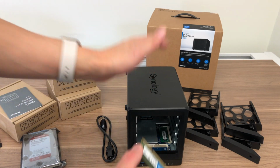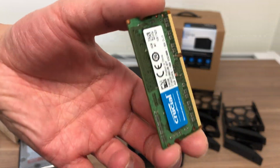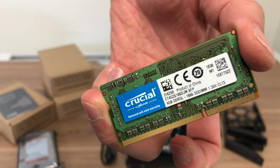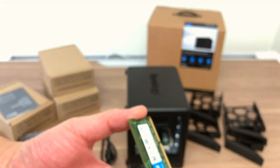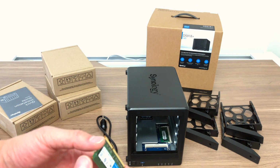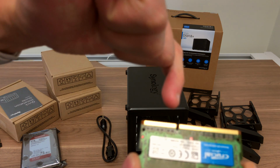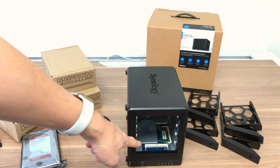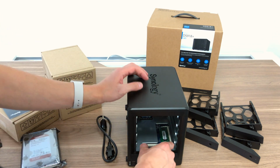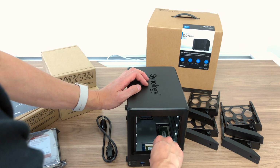Hey guys, so actually before I set everything up, I want to show you guys how to put in the extra RAM. So again, I got this off of Amazon. This is just a Crucial, and you can use this one. It's totally compatible. I'll drop the link below, right? And basically all you gotta do is, let's see. You have to take out all the enclosures, basically. What I do, I'll put it on the side like this, and just make sure that this little slot, the opening, is aligned with that opening right here. Like there's a little tab, and then you just put it in, and basically you just push it in, and that's it.